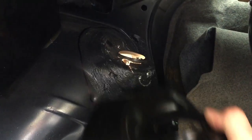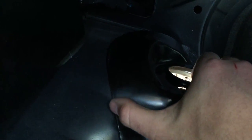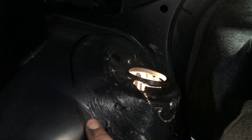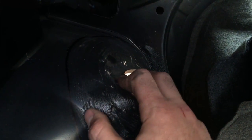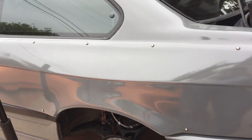I got my panel here, basically pushing it into place. I can't do this with two hands, so what I'm gonna do is trace around this with a Sharpie marker — that will show me where I need to cut. So as you can see, this Sharpie line here is the outside. What I'm going to do is bring this in about a half an inch so there's about a half inch of overlap. That'll make sure this is a nice strong bond — it'll be stronger to weld this type of lap joint as opposed to just a butt weld.